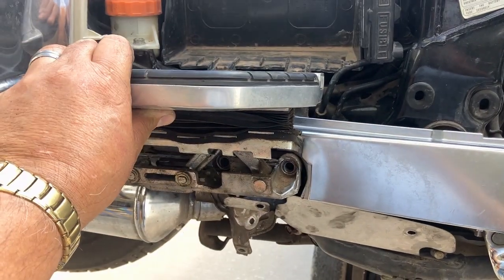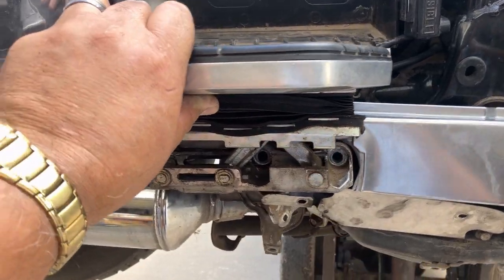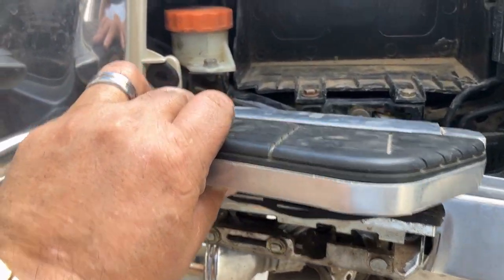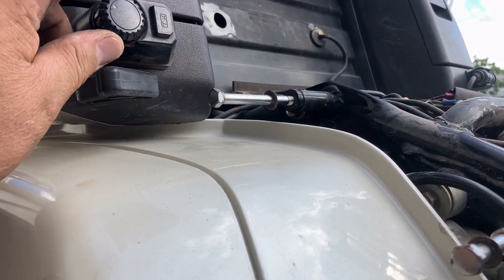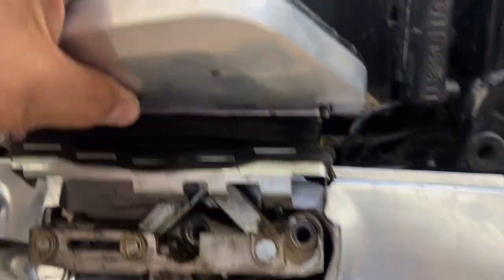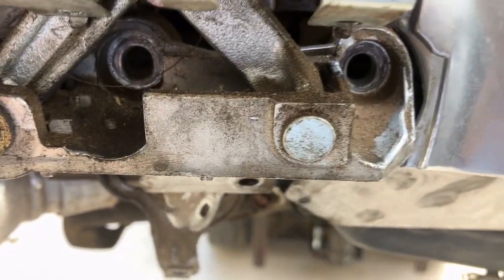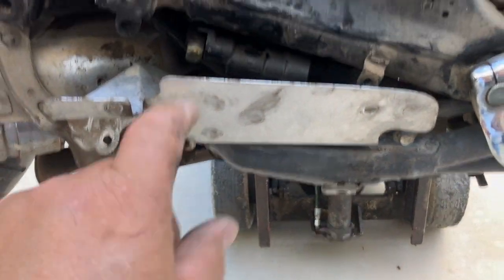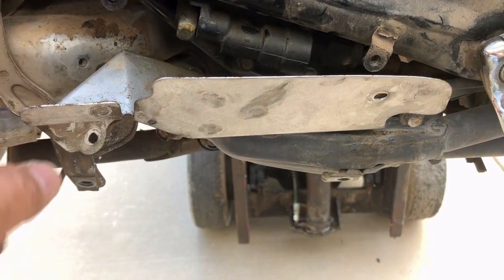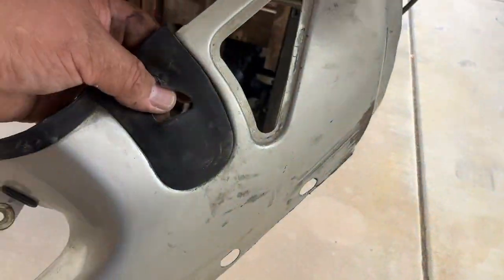The first thing you've got to do on this side is remove this passenger foot peg. If the foot peg is down — because these are adjustable — you have to turn this knob right up here. It's spring-loaded, so it'll come up and give you access to those two bolts right there. You've got to take those off to be able to get to everything else. The master cylinder is in behind these shields.